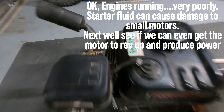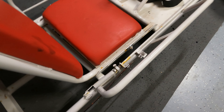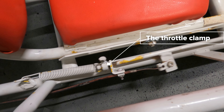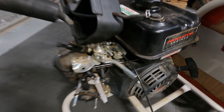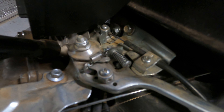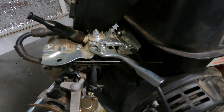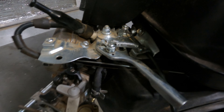So take a look at this throttle line here — it's hooked up correctly on this end. But over here there's a choke point, and why does it hit that before full throttle extension, and why is it crooked like that? The first thing I noticed is this return spring doesn't return anything but broken hopes and dreams. And also this doesn't even go to full throttle — the throttle screw is set in quite a ways.